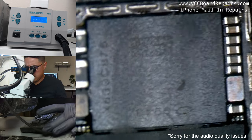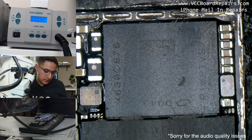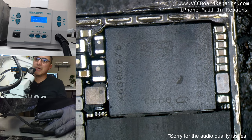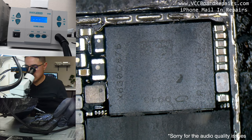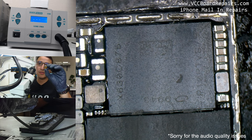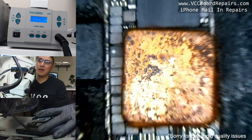The model I'm working on right now is an Intel version of the iPhone 7 — the A1778. This is an Intel baseband CPU. If you're working with a Qualcomm, it's the exact same process except that chip is square whereas this one is more of a rectangle. I like to use these little copper shims — I'll link them in the description. I stack four of them; that might be a little overkill but I think it's worth it.